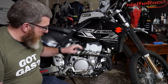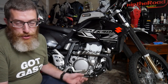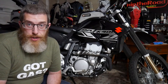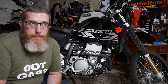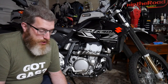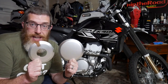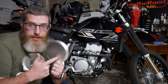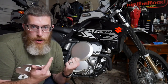Why? Because the engine case on the DRZ-400 is made of magnesium. Magnesium is very brittle, and because of the design of the brake and shift levers, it is very possible if you drop the bike for one of those levers to puncture the side of your case, have all the oil flow out, and get you stuck in the woods. So in order to prevent that, you install case savers. These are aluminum and they attach right to the outside of the case, giving it a little bit of flexibility and puncture resistance so that your levers don't go right through your case in a bad drop.